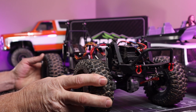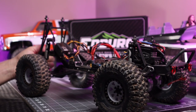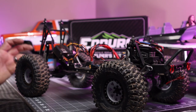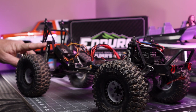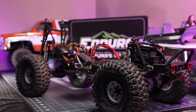The only other thing that is not factory is the shocks. The Desert Lizard shocks are very tunable — people have mixed emotions about them, but they are really smooth, I haven't had them leak, and they're extremely tunable. They come with a whole bag of springs and pistons so you can tune them depending on what shock oil you're using. They're really great for comp tuning. I have 60 or 80 weight in them — I think 80 in the back and 60 in the front, but I'd have to check my notes.